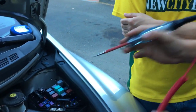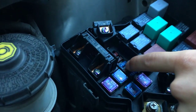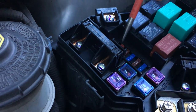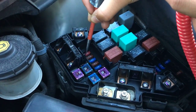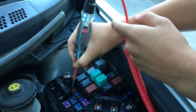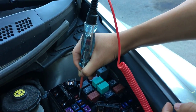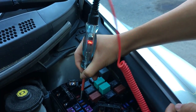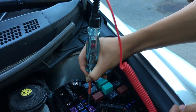What you want to do is take the sharp end, find the fuses, and these two metal sides — you can put the tip into either one. You want to touch the end to it and see if the light turns on. You can see the light turn on, and if you take it off, it turns off. On each side the light turns off. And you can see the light turns on for all five of these fuses.